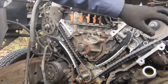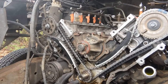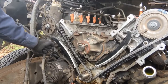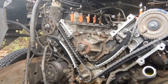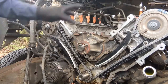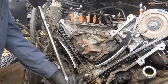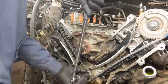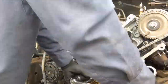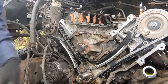Double check your cam marks — make sure they line up on both sides. Come down and double check your crank mark. We are good. Go ahead and pull the grenade pins and it should be tight. Now we want to turn the crank one full revolution to make sure everything is still good and nothing's binding. That is one full cam revolution, two crank revolutions — everything felt good.